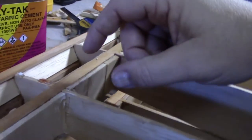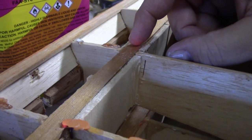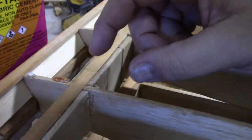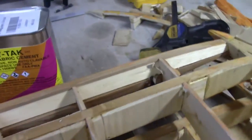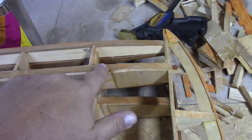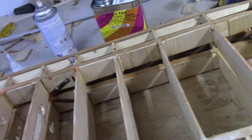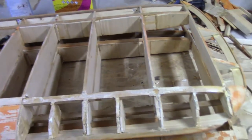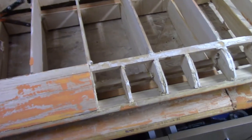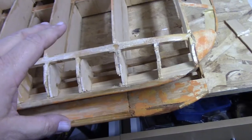It's so darn low, I don't even think I can get it to. Well, you can kind of see my fingertip getting red. All right, so it has not bent. It is level all the way out to here where it starts dropping. So I'm not concerned about the rear spar on the wing. It's the front one. That's where I think the wing itself was not built in properly. I think it was all from the repair of the wingtip.